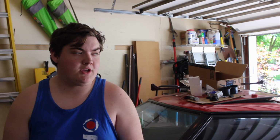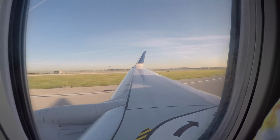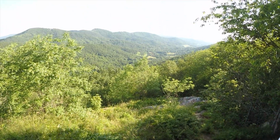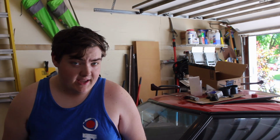Alright, so it's been almost 2 weeks really since I've touched the car. That's just because I flew out to North Carolina for a while to surprise my girlfriend and see an old friend, and then just scheduling conflicts between me and Adam. But today, hopefully the plan is to take a look at why the engine isn't holding an idle. I think it's something with the injectors, timing, or vacuum lines. So we got some starter fluid that we're going to spray around the vacuum lines, and if the engine speeds up, then we know that there's a vacuum leak.